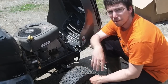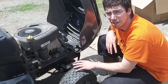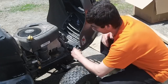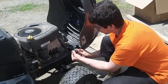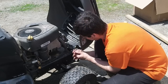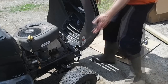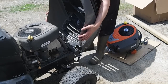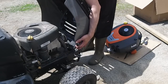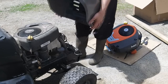The first thing we're going to do is get this hood out of the way. It's not strictly necessary but it makes the job so much easier. Take this section of wire and unclip it, then grab the hood on each side, tilt it slightly forward, lift straight up, and then slightly forward some more and it comes right off.